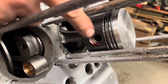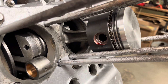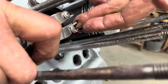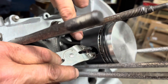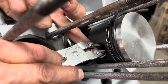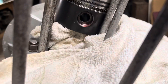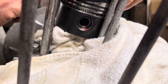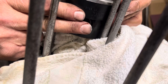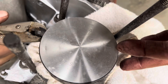These snap rings are important because if the wrist pin moves it'll score your cylinder — they keep it centered in the piston. There are all kinds of different types; these happen to be the snap ring type but I've seen wire ones and all different kinds. Be careful — if one falls it could go in the motor and ruin your day. Now with the ring holding the wrist pin in, drop the compressor over the piston. We want to make sure we get all the rings a little bit below the surface — that'll make the cylinder easier to slide on.